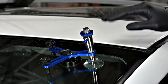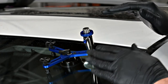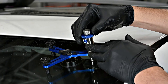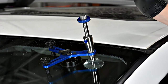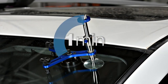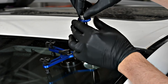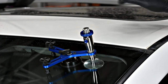After two minutes of pressure, we evaluate our repair. If it needs more time to get the resin into the cracks, we can go to a second vacuum and a second pressure cycle. We do that by opening the air release valve, turning the plunger, pushing it down, locking the air release valve, and drawing the plunger back into a second vacuum cycle — let that sit for one minute. Then we open the air release valve, close it, and drop the plunger down into a second pressure cycle and let that sit for two minutes.